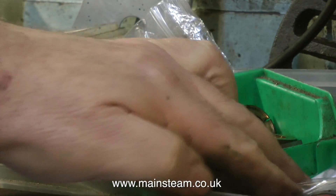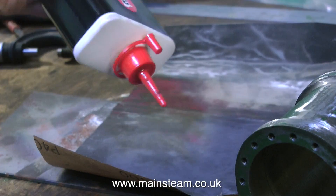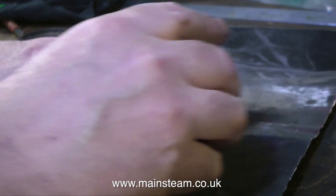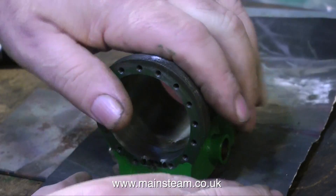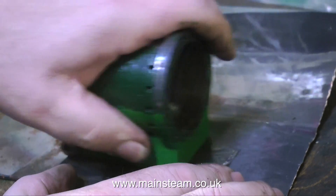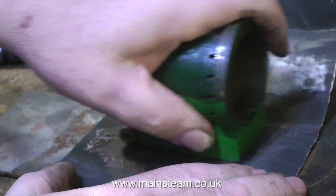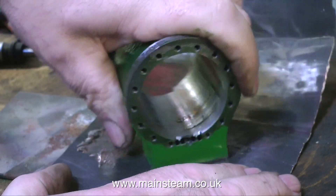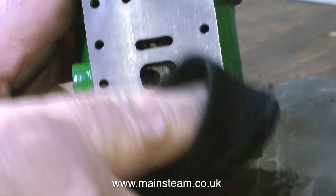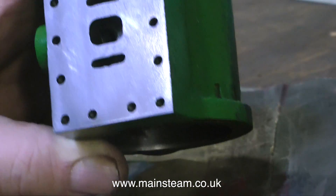I put all the studs in a plastic bag, which goes in the box of bits, and I can have a detailed look at the cylinder. The main ports do not look bad at all, but I'll just make sure that everything's nice and flat. I'm doing this by rubbing the cylinder on a piece of 400 wet-or-dry sandpaper, which in turn is on a metal plate known to be flat. Ideally you'd use a surface plate or plate glass, but this gives a good finish.